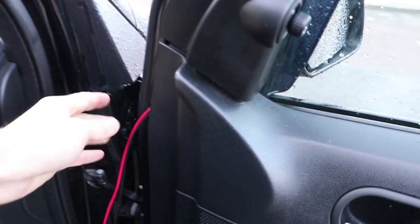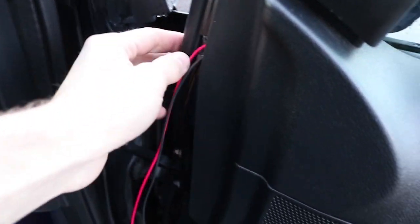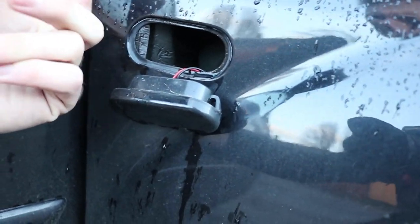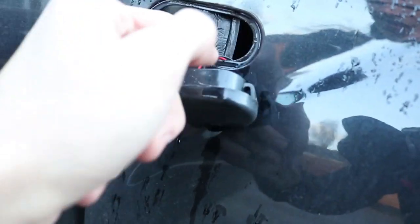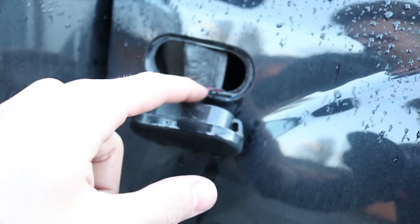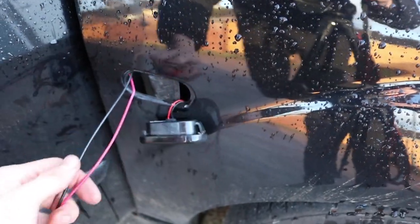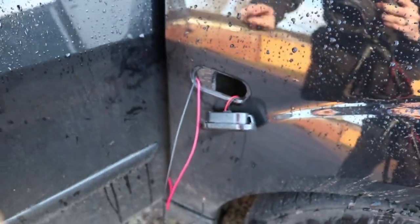We've got the wires coming down through here. I'm going to put them just behind the door seal, feed them down through here somewhere, probably down under here, and then we've got to feed them into the side wing - down through here. There's just like a foamy thing which we can probably just move slightly, which it looks like we can. I'll tap into these and then that will be our power for this. I've managed to feed the wires down through the door, just around this little crack here, and I've fed them through there. So now what we're going to do is just tap into these wires here from the side repeater, then just hide all the wires, put this foam bit back, and then that should be that powered.